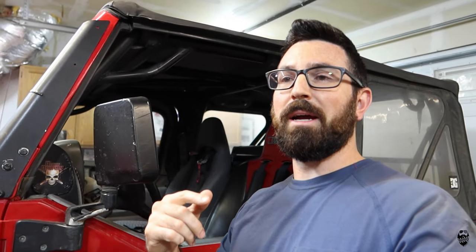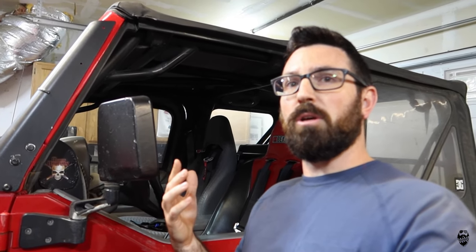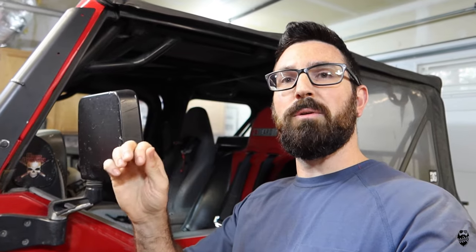So went straight back home, parked it, and I decided to just readjust the bands just to be sure. I loosened up the adjuster for the bands and it felt really, really loose, like I could tighten it in way farther than I feel like I should. So I tightened it up a little bit to 72 inch pounds, backed it off two turns again, tightened it up, drove it around, just didn't make it very far and it was still slipping really bad. So I immediately turned around, using first gear only, and came right back to the shop and left it like that last night. Today I came home from work and I pulled the pan off, pulled the valve body off, pulled it apart, and I will show you what I found.